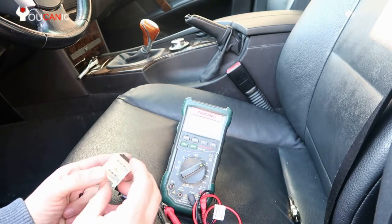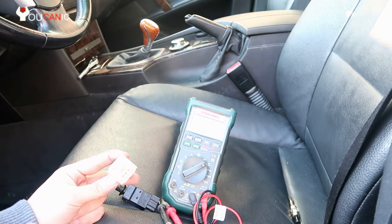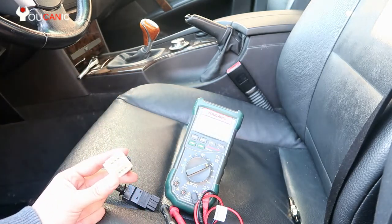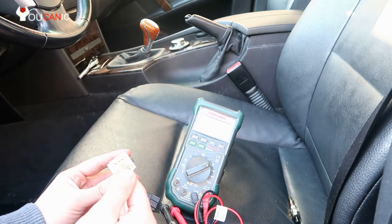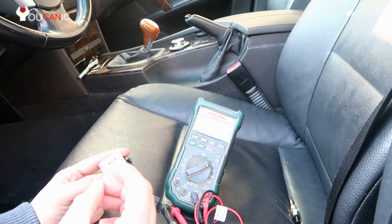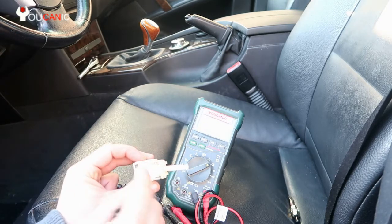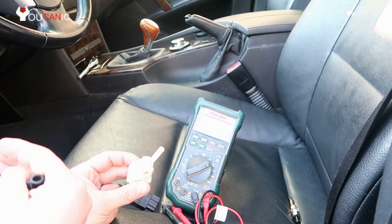With a modern car, these brake light switches are getting more complicated. As you can see here, this one has three terminals on one side and three on the other. This switch is not only used to turn on the brake lights, but also to move the shifter from park to drive — if you don't have the brakes pressed you can't shift. The signal also unlocks the electronic steering column. There's also a different switch inside with different contacts: when you hit the brakes really hard, it detects an emergency stop and uses ABS to help you brake faster.